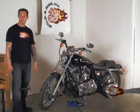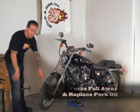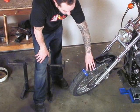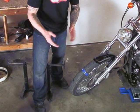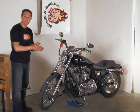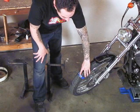From here, we're going to check our neck bearing adjustment. And we're going to do that by marking our tire and performing what's called a fall away test. And that's going to be centering our wheel and tapping it from side to side, and when the bearing starts to lose friction, the wheel will fall away. And let me show you how that's done.